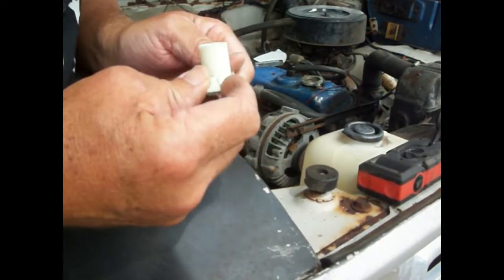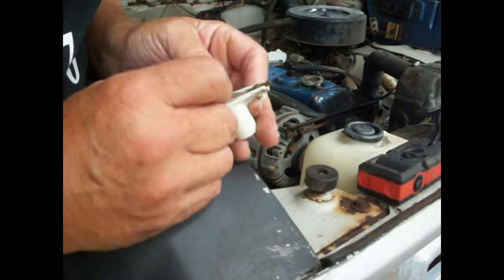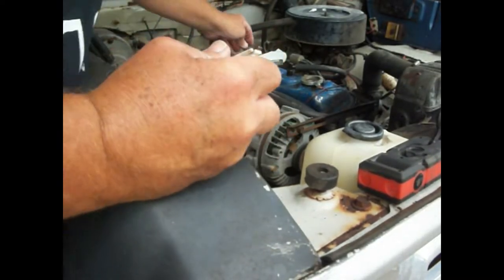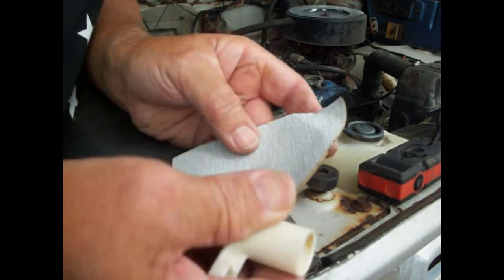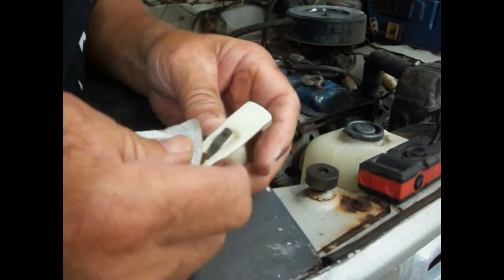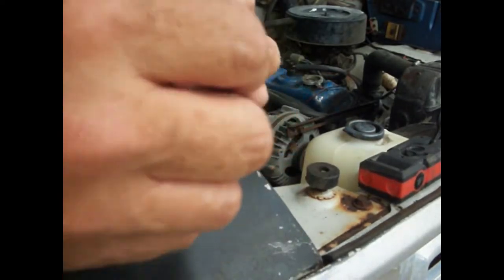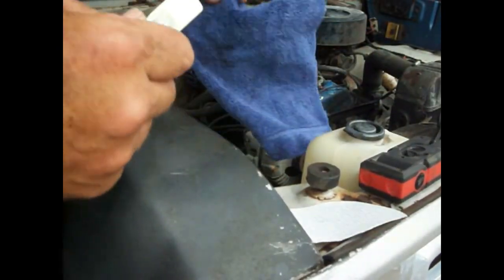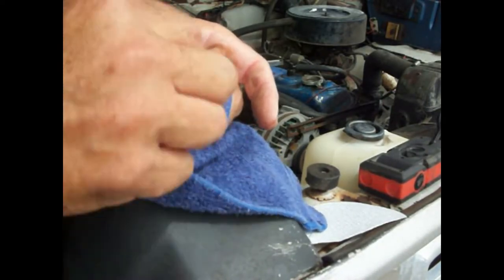So we've got our rotor here. I kind of looked it over — I don't see anything really wrong with it, other than it's got a little carbon track there and it's a little dirty. I do know from the previous owner that it has been off the road since 2018. So we want to just kind of look it over. I don't want to put much into it yet until I find out if the head has to be pulled or whatever. But if we can get it to idle on all six cylinders, well, that would be a handy thing.